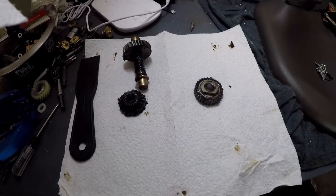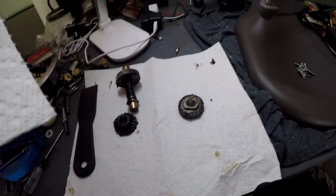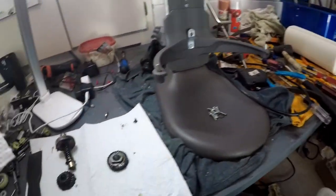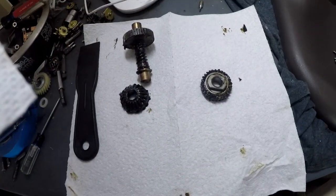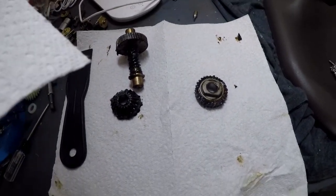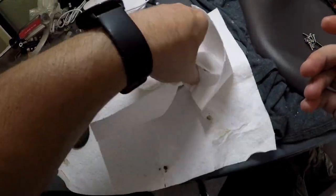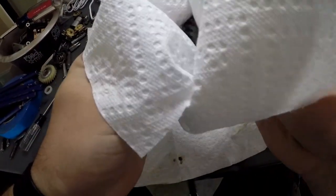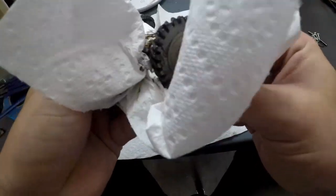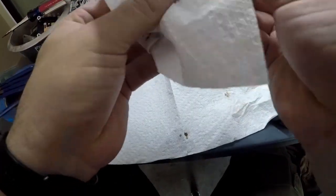Now that we've got the gearbox cleaned out and all the gears out, this is where our paths are going to make a little segue because I have that little blue thing there — a lovely parts washer. It makes this super easy, but I'll also show you the old fashioned way, which is how I used to do it before I did this full time. What you're going to want to do is get a paper towel, pick up a gear, and just clean these off. Give it a few wipes — you can tell how much cleaner that is already.